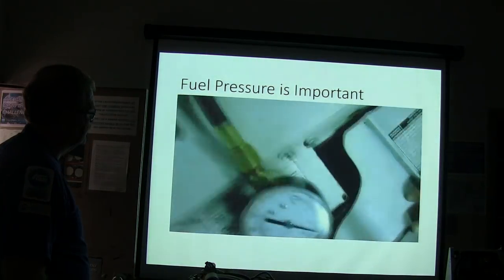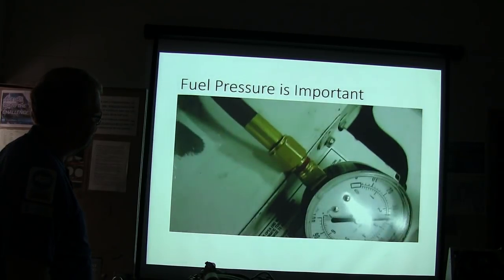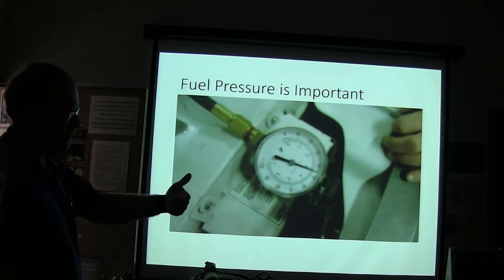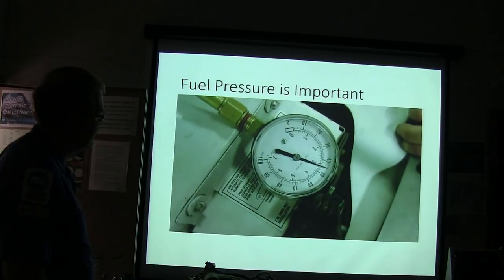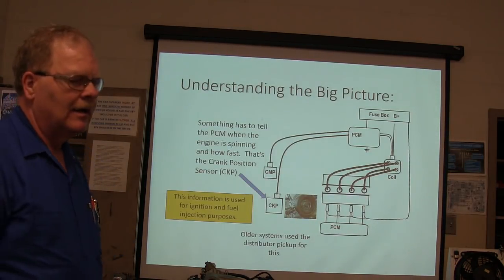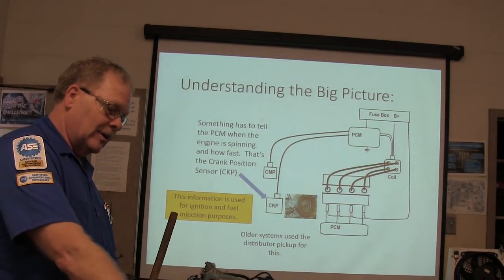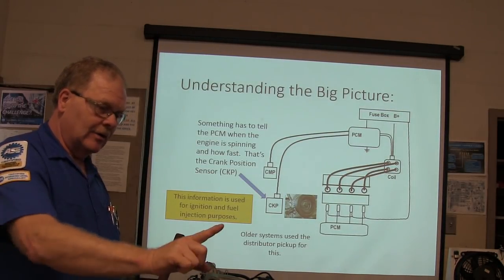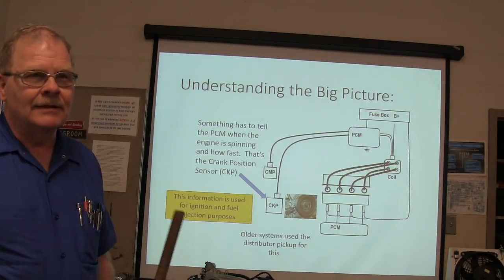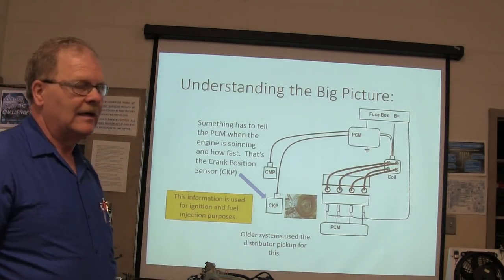In order to diagnose this car, we're going to pull a vacuum line off the fuel pressure. That's a bad fuel pump. I'd often see a motorhome come in with 80 gallons of gas in the tank — I'd put my fuel pressure gauge on it, pop the fuel pressure regulator vacuum hose off so it would jump up to 40 pounds, snap the throttle, and the pressure would drop. Filter's already been replaced — you need to put a pump in it, and here's 80 gallons of gas in the tank to deal with.